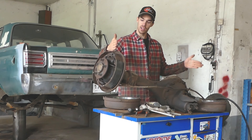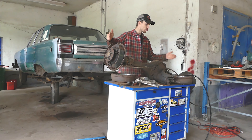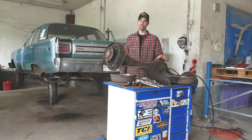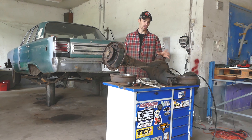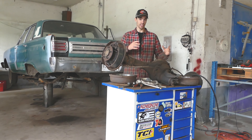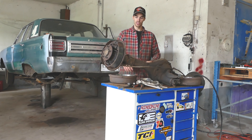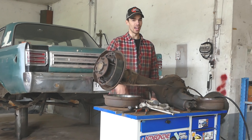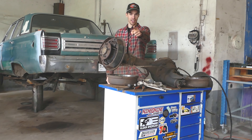I'm going to see if we can zip those off, move each side an inch out, re-weld it, and put it into the Challenger. It has a 355 sure grip unit in it, so it's pretty good for highway and acceleration. It'll also lock off both wheels and do two black lines in the road instead of one. And yes, this thing is burnout certified as you can see right here.